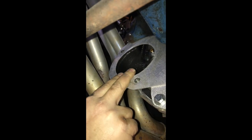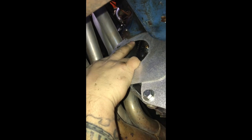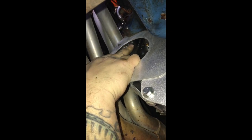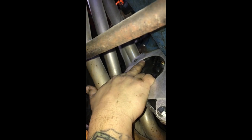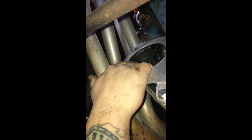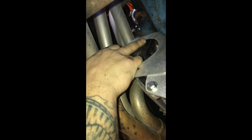Nick has found what's going on with the starter. The hole that the nose of the starter protrudes through on the plate is hitting at the top, and you can actually see it's starting to bend in around the case of the transmission. So the next step is to pack the inside of the bell housing with some paper towel, get the Dremel out, and open this hole up. It only appears to be hitting here, so we're going to open this radius up about a third of the way toward the transmission case.